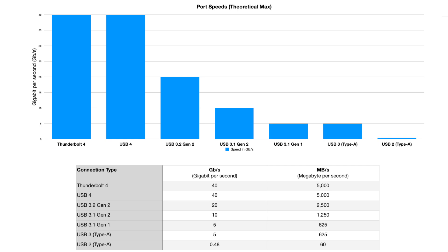So I'm guessing that there's some weird USB handshake or miscommunication issue. While looking around online, I did find a lot of posts asking the same question I was — why wasn't this SSD as quick as it was advertised? But one comment stood out to me. They said that if I took a Thunderbolt 4 cable and plugged that into a Thunderbolt 4 port on my Mac and then plugged it into this SSD, I should get faster speed performance out of this than the included USB-C cable.